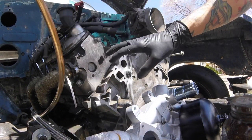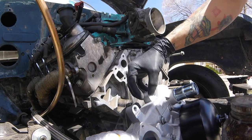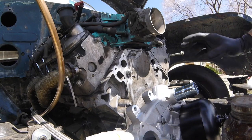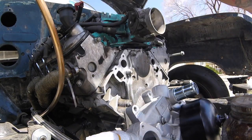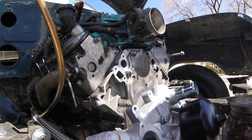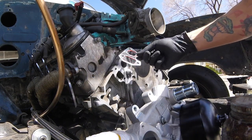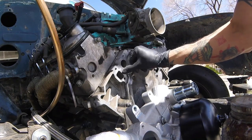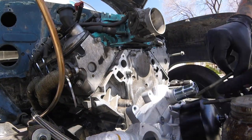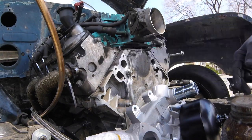If I'm about to mount the compressor mount right here, and that mounts on this pump as well, I don't want to have to pull all this off to get the pump out and do it later. So I'm going to do this now, then put the compressor on, and then not have to deal with it for another — I don't know — probably 100, 150,000 miles. So now I'm just going to, just for funsies, put some ticky-tack on here so I know it's nice and sticky, and on the back of the pump. I'm also going to apply some anti-seize on these threads because they're steel going into an aluminum block.